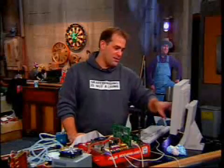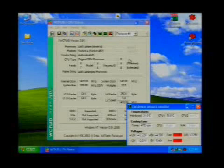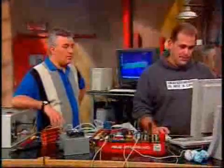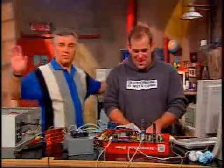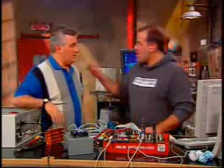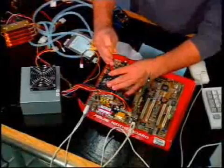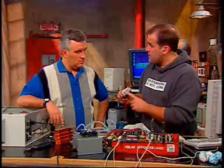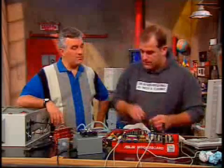We've got this one running at 1,470 MHz at 140 MHz on the front side bus. My system maxed out with the stock fan from AMD at about 1,575 MHz. So you're overclocking — running it faster than the rated speed — and cooling becomes so important. The 1600 didn't fry because of the overclocking; it fried because I improperly installed the cooler. Even if you hadn't overclocked it, it still would have cracked. With the stock AMD cooler it ran at 150 MHz on the front side bus — from 1,400 MHz up to 1,575 MHz, running at about 50 degrees centigrade. You bumped the bus from 133 to 150.